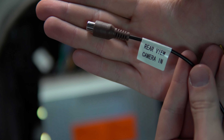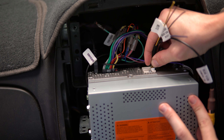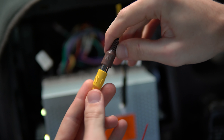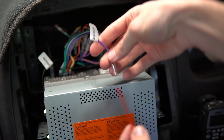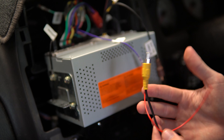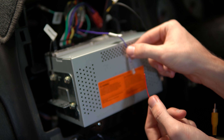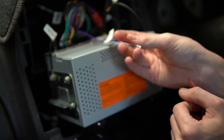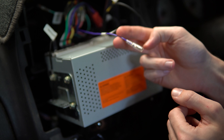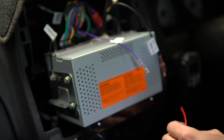First we'll go to the back of the head unit and wire these in — we'll also have to figure out the reverse signal. We're in the car now and we obviously have to take all this fascia off to get access to the back of the head unit. For the D22 Navara it's pretty simple — just two little screws and it's all clips, so take those screws off and it just pops straight off. If you've got a trim removal tool, try to use that so it doesn't mark up the fascia. If not, a flathead screwdriver does the same trick — just be careful, you can scuff it up.